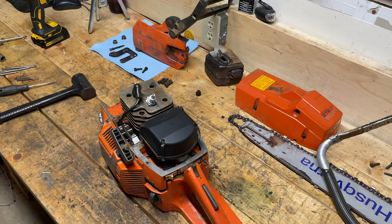I just put all brand new gas in. There's no chain, no bar. I'm going to lock the choke on, lock the throttle on, and pull it to see if it starts. Keep in mind there's WD-40 in here still, so I want to make sure I give it a good fair chance. That's pretty promising — so it'll start and it'll run. Great news. I'm going to pack it away for the night — don't want to upset the neighbors — but I'll show you the rest of the video tomorrow once I get it all completed.